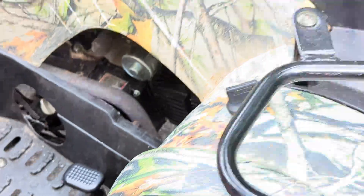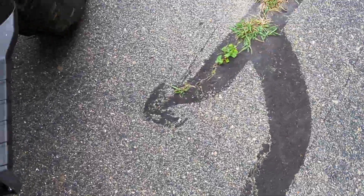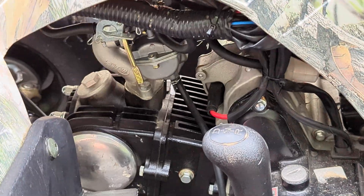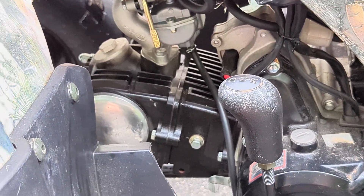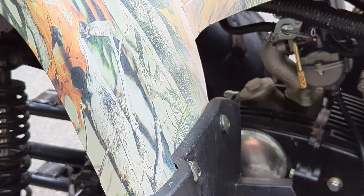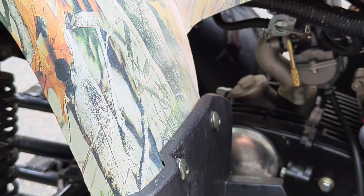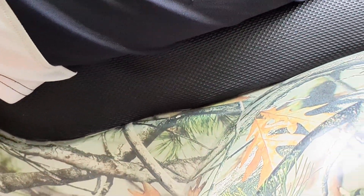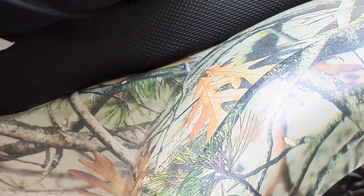For other regular maintenance, make sure your tires are pumped up to 24 PSI max. You can have it higher for road use and lower for off-road, sand, and that kind of thing, but don't go above that. Your battery is underneath — if you don't use it for a long time, put the battery on a battery tender. That's about it for your maintenance.